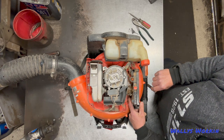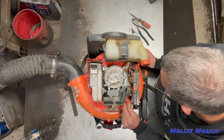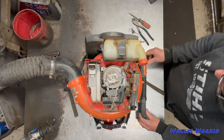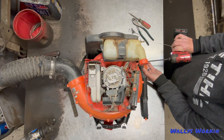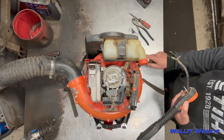There's a little wheel on the top of this air filter housing that the throttle cable goes around — just undo that. Now you can go ahead and pull that whole assembly out of the way and it's clear. Next, I'll unbolt the throttle from the body itself as well, and then just feed the wires through the frame.